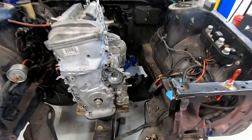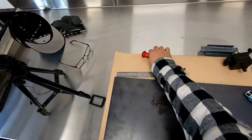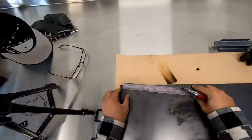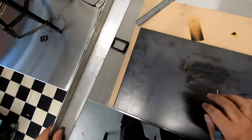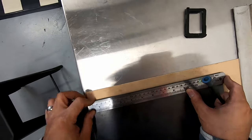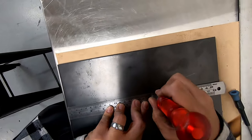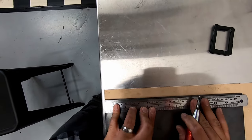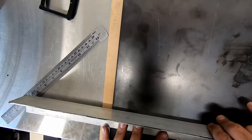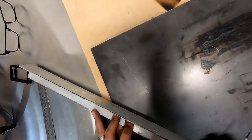Once you've lined up the motor and trans in their final position, it's time to start making the mounting brackets. I'm using 6mm mild steel here, but pick the right material that suits your job. First off, start out with two squares — these will sit on the rubber mounts. Then you can start measuring out the plates that will attach to the engine, and start adjusting to the socket.